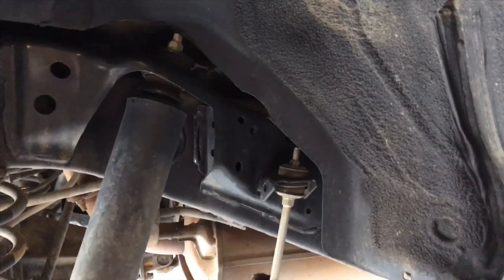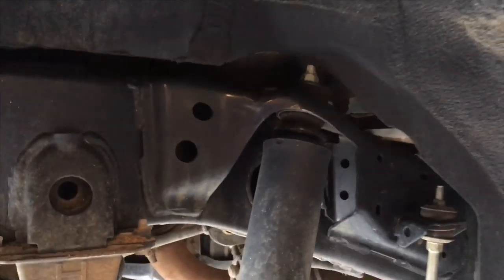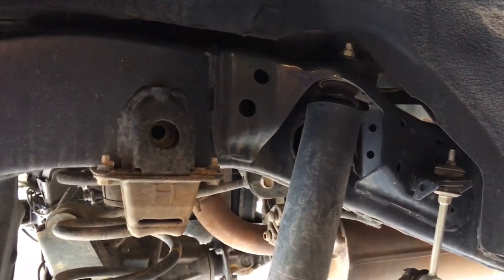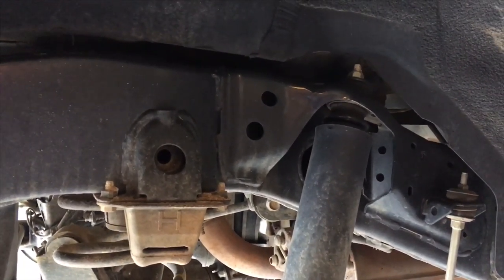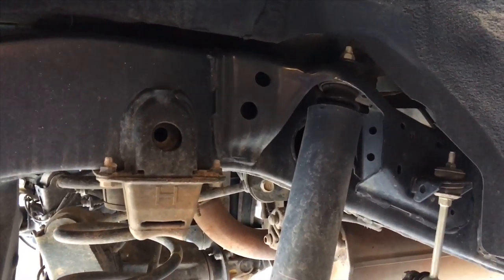The next step is we're going to cut. We'll do two steps at once. I'll tell you about the first step. I won't show you, and we'll see if you can find it yourself. And if not, in the next part of the video, I'll show you. There are two 12 mil bolts we're going to take out, one in the brake line and one in the ABS lines up above the rear diff.